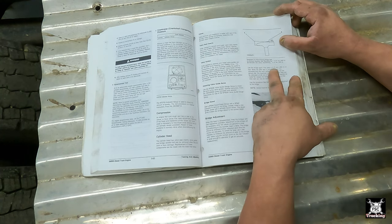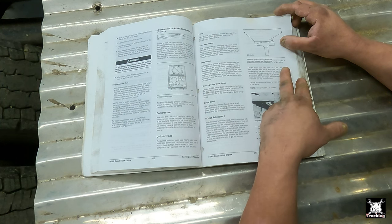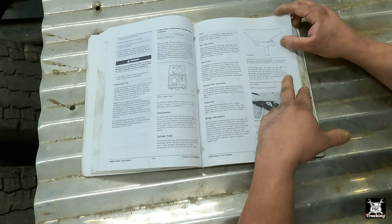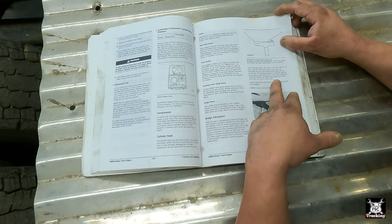Use the bridge again if the wear is 0.13 mm, or 5/1000ths of an inch, or less. If the wear seat is worn more than the allowable limit, the worn surface seat can be ground flat. The maximum material that can be removed is 0.15. If the seat cannot be made flat, replace the bridge. Reconditioning the wear seat can only be done once.